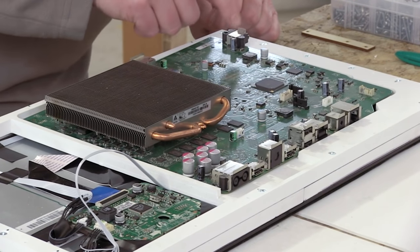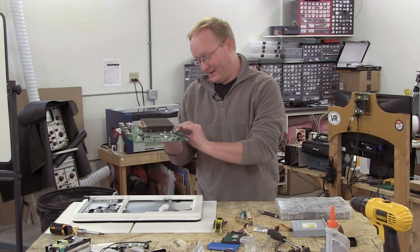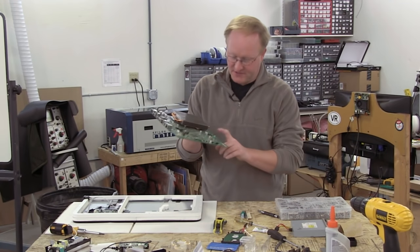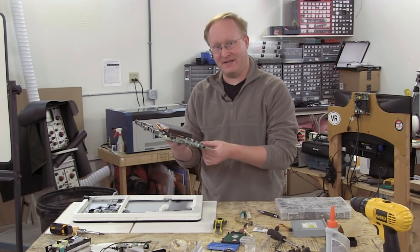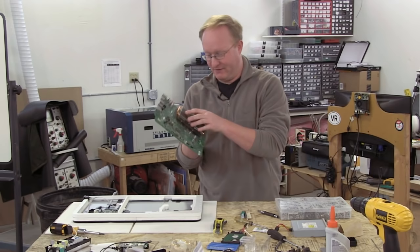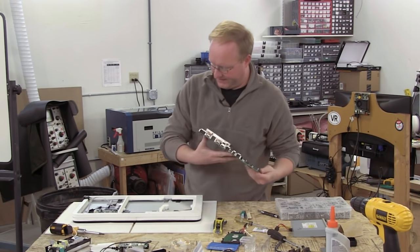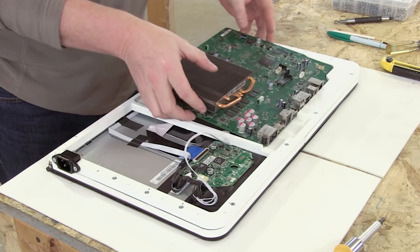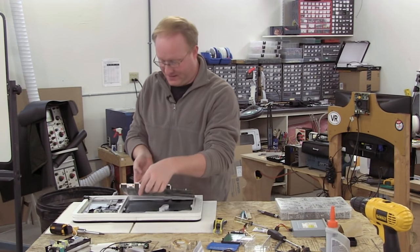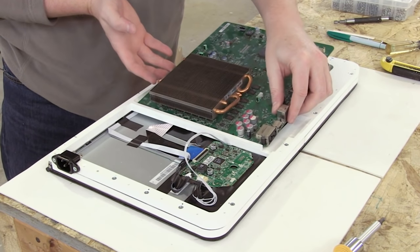I removed this USB port, the front panel header, and I also turned a few of the capacitors sideways to give us a low profile here. I'd use the blowtorch because, as I've mentioned many times, there are internal ground planes on modern boards and it's really hard to desolder pins from there because the heat sinks everywhere. So I actually hit it with a blowtorch — I used to do that a lot when I would modify Xboxes. So this sits here in this cavity. One thing I want to check is that the X-clamp — they're still using the X-clamp — I want to make sure this X-clamp doesn't actually touch this metal. It shouldn't make a difference, but I still don't want it to happen.